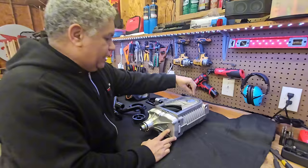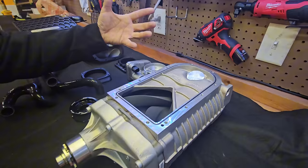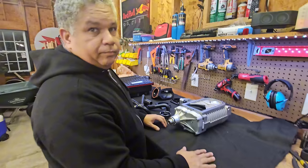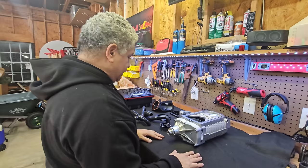This is a 1.9-liter blower. One difference you'll notice — we worked with Harrop to make this a custom blower, not only in the nose size but also with bypass elimination, since the Audi cars run an electronic bypass. They sealed it up really nicely. So that means we're not using the vacuum-actuated bypass that normally comes on these units. That made the package very narrow and very slim, which is perfect.